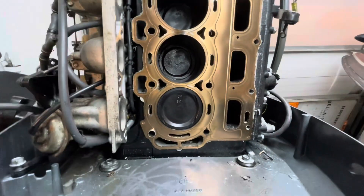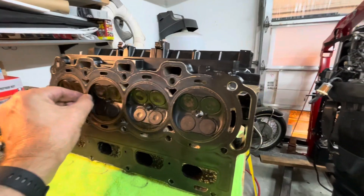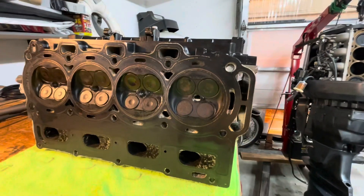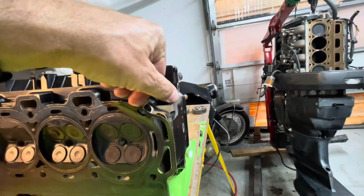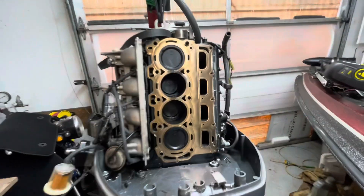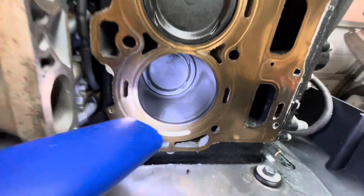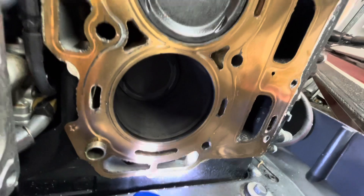When I got it I was able to turn the engine. I've got to make sure and see if it's flat. I can see where the head gasket failed, but I don't know why it's in two pieces. I'll inspect it some more and let you all know. Very interesting. And here, looks like scratches there but I don't feel nothing.